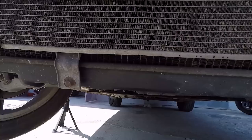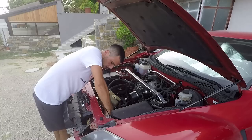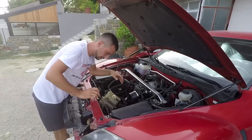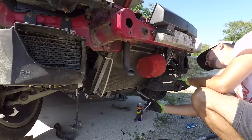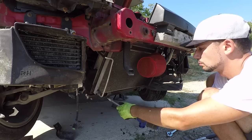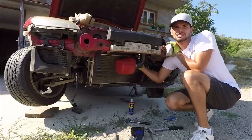With the upper part done, it's time to move to the front. Here I have to release two bolts on the bottom and two on the top. At this point, I think it's smart to secure the radiator with some zip ties, so that when all the bolts are removed, it doesn't just fall on the ground and possibly damage the newly installed fan shroud. If there were a second person here to help, this job would have been much easier. The bottom bolts were very easy to get loose but somehow refused to come out, and the top bolts were just as stubborn.